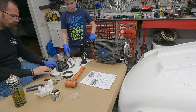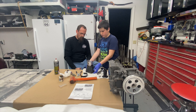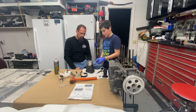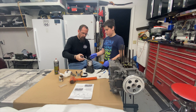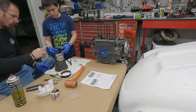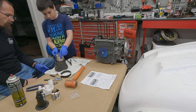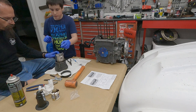Where's your wrist pin? It's going to come in from this side. Put your wrist pin in. Let's get a little oil on the holes, and on that — smear it around with your fingers and then slide that in. Watch where you're putting your fingers though — you've got to be very mindful of where you're putting things.